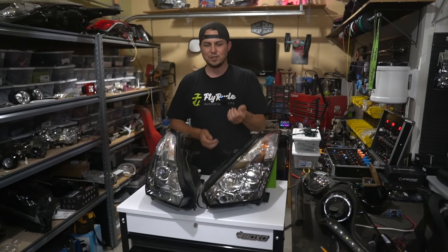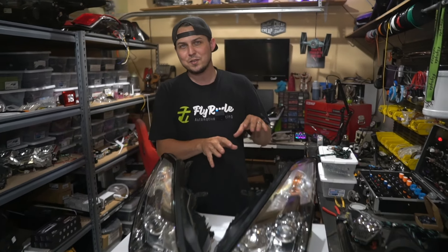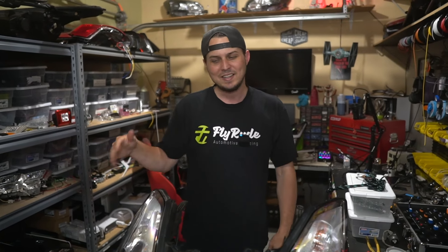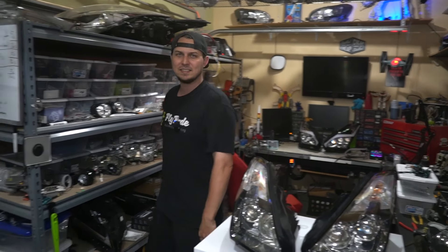So there we are — how to reseal your lights and get them ready to go back on the car. Don't forget: use retro rubber. Even if you've got perma seal and took everything apart, don't use some weird silicone stuff that has to cure and gas out and stain the inside of the lens. These things are ready to bolt onto the car immediately after sealing — no cooling, no curing, nothing like that. Don't cheap out, don't be in a rush. Use the right material, use the right tools, and go watch my video about how I open these things — it was way easier to reseal them because there were no pry marks since I opened them with just my hands. If you got through this whole video, comment below 'I watched the whole thing.' I hope you enjoyed and I'll see you next time on How Tuesday.